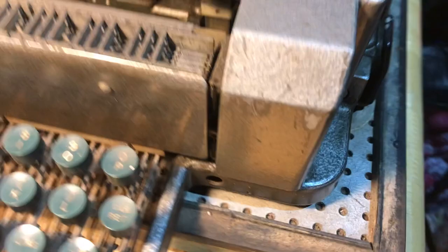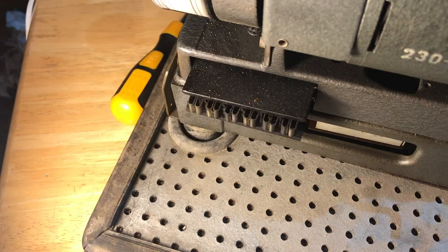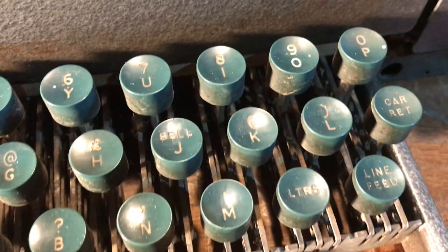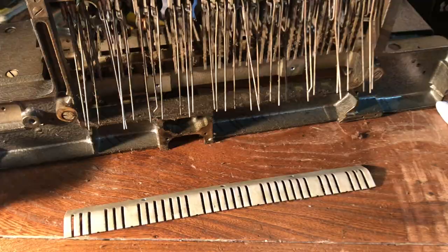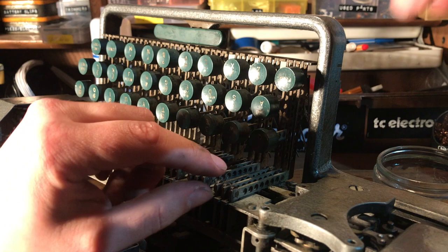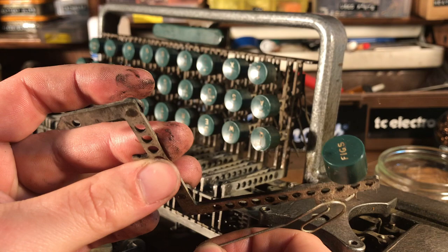Next on the list is the keyboard unit — it comes off two big screws. This pulls forward and you can see on the back there are some contacts which slot in here, and the motor drive indexes. Here it is in close detail — quite grubby, quite a lot of places for dirt and grime to get into. I might take this one a bit further apart both because it's quite hard to clean in there, and because the mechanism is really cool. This is underneath the keyboard — these are all the springs, and this is the retaining bar that indexes with those springs and the bottom of the keys. I removed a couple of retaining bars and now I can just remove the keys one by one and clean them up.